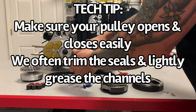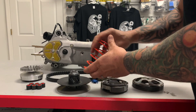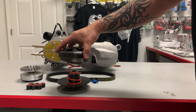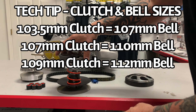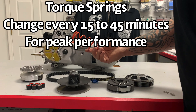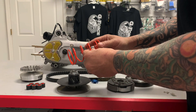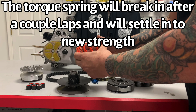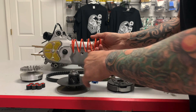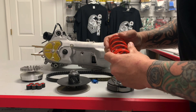We have the rear pulley, and the next major component is the torque spring. This sits in a cup, then your clutch goes on, and then your bell — this is how it looks when fully assembled. It's important to have the right torque spring and to change it often, as much as every 15 to 45 minutes. There are different colors, different strengths, and it's not just overall strength — you have to look at how much it takes to compress it versus just the initial push. There's spring rate, different lengths, a lot of variables. We always recommend consulting a professional race shop to get your baseline CVT setup.